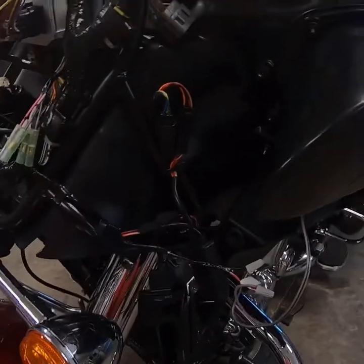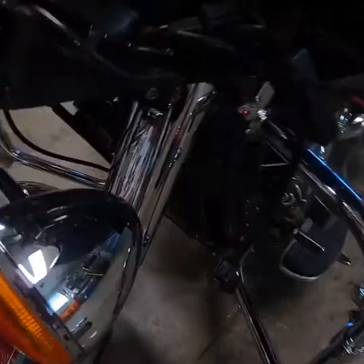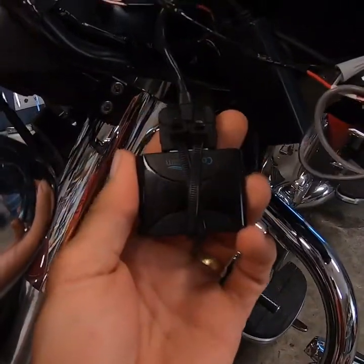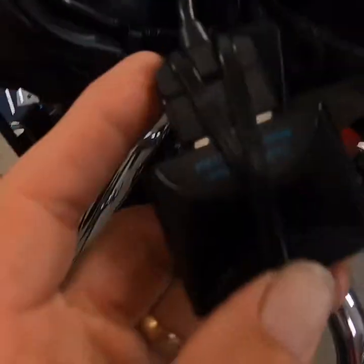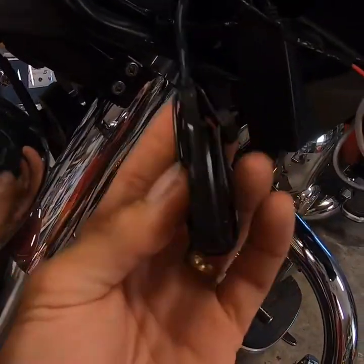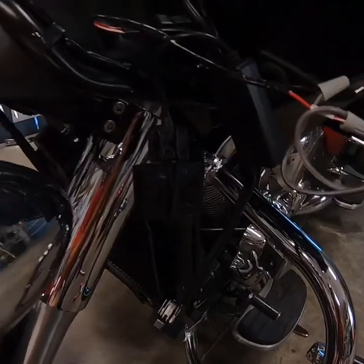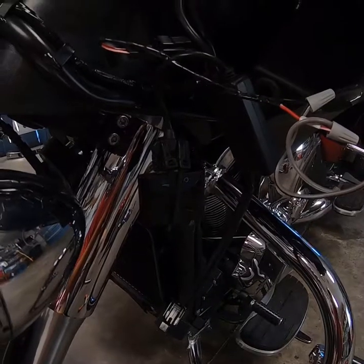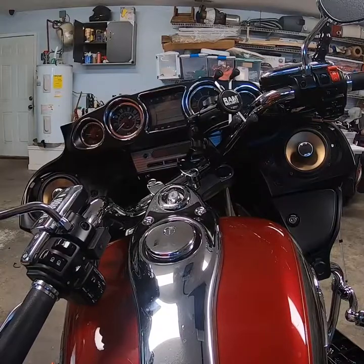As it sits right now, I could put it back together from the front without tearing the fairing off again. First I tried taping it, but that didn't look like it would work very well. So what I've done is put two zip ties around it in an X pattern — pulling left and right evenly on the connector so it's in there nice and straight, not pulled off at an angle. I'm going to turn the bike on and check it to make sure it plays. Once I know for a fact it's playing, then I'll proceed with mounting it.